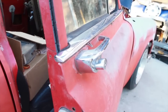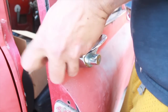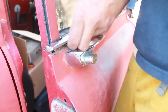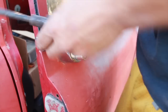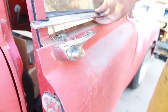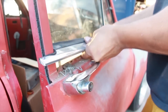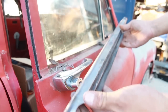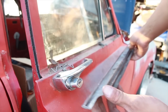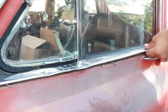There are three clips on each side, and once you have the clips, just evenly and slowly pry it up and slide it back and pull it out. Not too much damage on this side. The driver's side though, we're probably just going to leave that off because it's more work to fix than just to replace. So until I find a new one, say bye to this old trim piece.